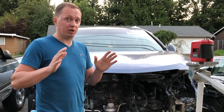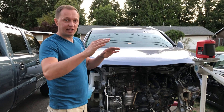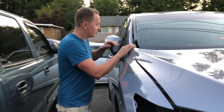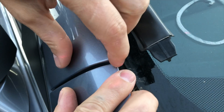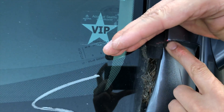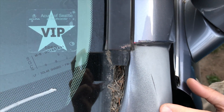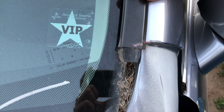The very first step, and it's very important: you have to make sure that the car is level side to side. The way I have this laser level set up, it comes up to the height of these corners right here. You can see the laser is hitting this very corner, and we have to have the same exact thing happening on the other side of the car — same thing, hitting this corner — because both of these points on either side are in the same exact position. That way we know the car is 100% level.